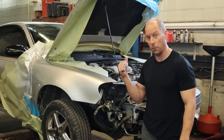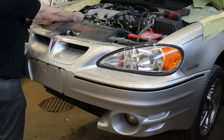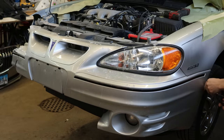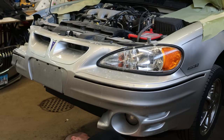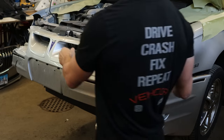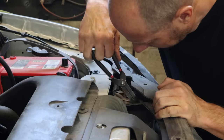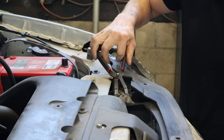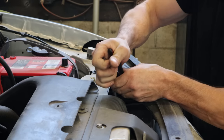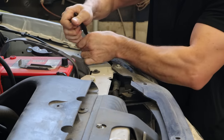The painting is done, so our Grand Am is all painted. Let's throw it back together — but first we've got to take what's left of our bumper off here. We left the bumper on the car because I don't want to have to store all the parts and fasteners. We'll pull out the closeout panel held in with push pins, one push pin on the bottom of the bumper, unbolt the splash shield on the driver's side, unbolt our bumper from the fender and pull it off. On today's episode of things you don't expect to find — looks like a bird or what's left of a bird. Looks like he tweeted his last tweet.